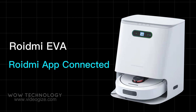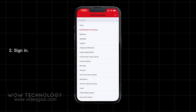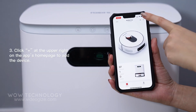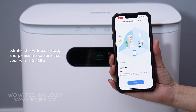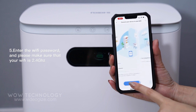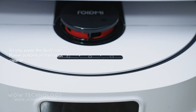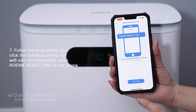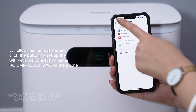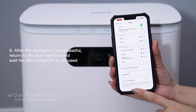Next is connecting with the application. Here's how to use the app: scan the QR code or search for ROID me Cleaner in the app store to download and install. Sign in, then click the plus sign at the upper right corner on the app's home page to add the device. Select the robot cleaner from the device list, enter the Wi-Fi password — make sure your Wi-Fi is 2.4 GHz. Long press the spot and power buttons on the robot cleaner, follow the instructions and click the button to set up the Wi-Fi with the connection name ROID me Robot XXX on the phone. After the connection is successful, return to the app interface and wait for the connection to succeed.